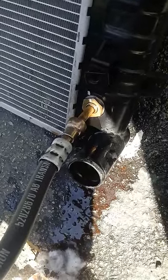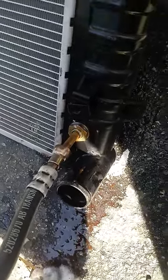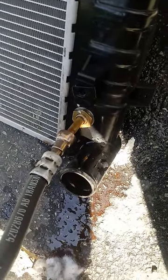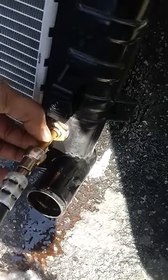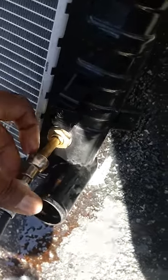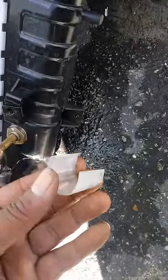If you're like me and you already have your stuff pulled out of your truck and you're stuck, what I went ahead and did is I took a look at the tool, figured out how it worked, and just jimmied my own tool. Basically, you need something that can push in between the cylinder and the hose to release those clamps. What I did is I took an old milk carton and cut out a little piece of plastic.